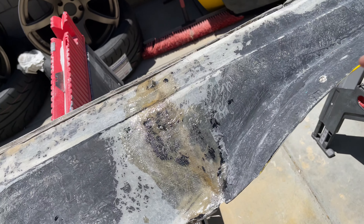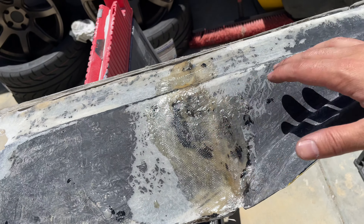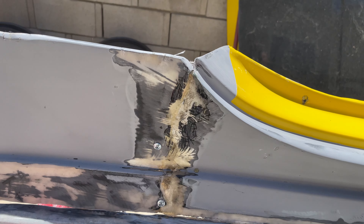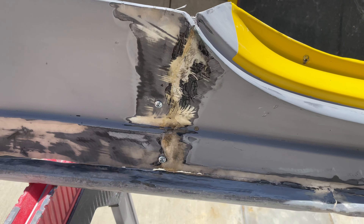The whole time I've been working on that, I got the first coat of fiberglass resin laid on the back of the side skirt, and it's turning out all right. Even though I don't like fiberglass repairs, I think it's going to look okay. We've got a nice coat of resin — there's some mat in there, and it's actually already dry. You can see I used screws just to hold it together temporarily. We'll end up pulling the screws out, sanding the front side down, and doing some more mat on the front.